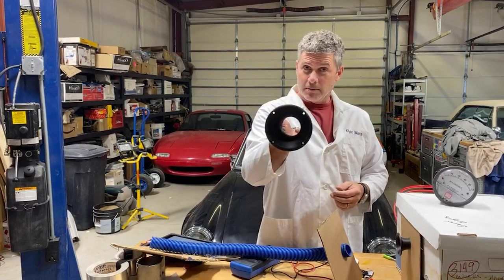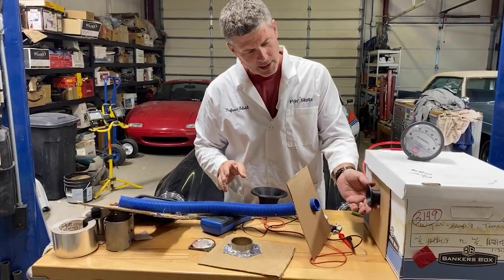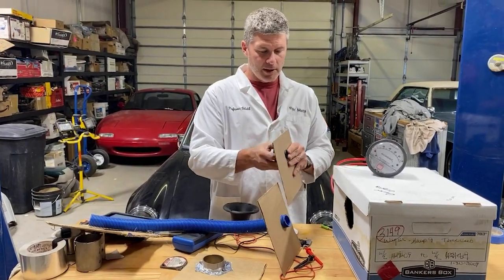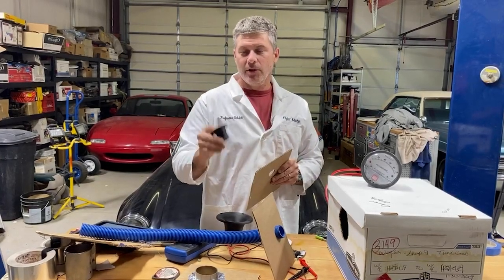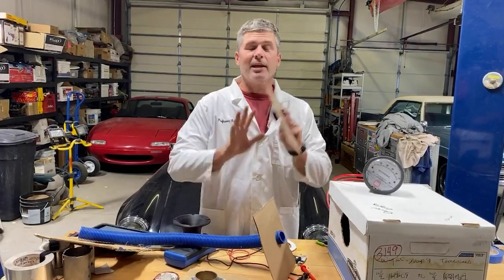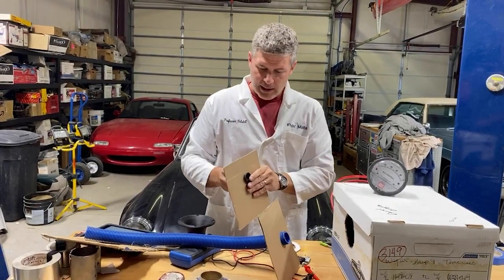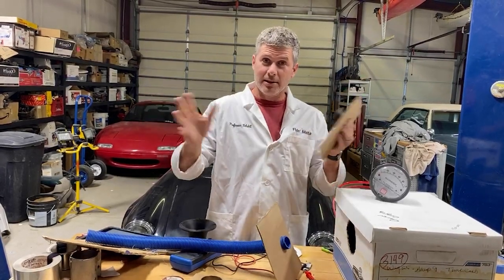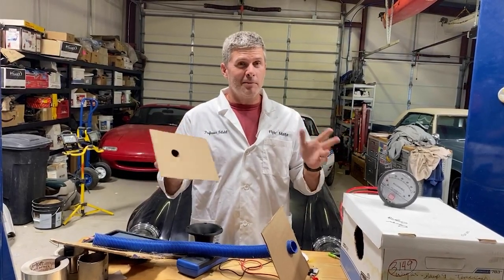Anyhow, bellmouths work. We just showed it. I can fire it up again if people want to see that and tape that to get a little cleaner data. But yeah, bellmouths do actually work. A goofy little thing like this can improve the flow through a hole dramatically. If you ever open up the intake manifold for, say, an E39 M5, it's got 8 bellmouths hidden in there. It looks like a bundle of snakes. They're all going different directions, but they've all got that little bellmouth on the end. Fun little side note. They also make a great noise when you take the plenum off the intake manifold. I highly recommend it. If you have an E39 M5, take the plenum off, and you've got to at least rev it a little bit. Sounds so good.